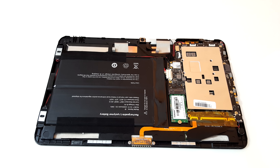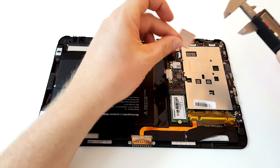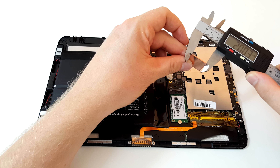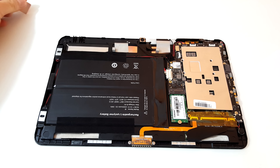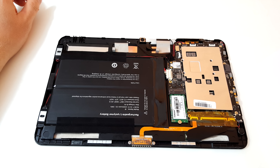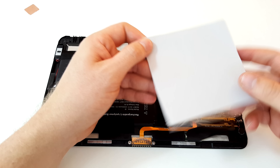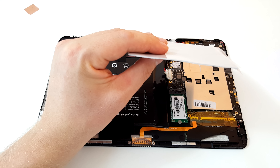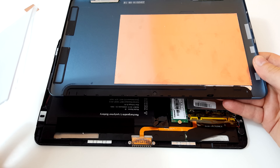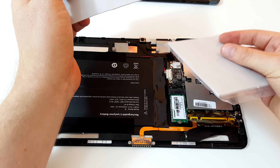There are a couple of things we can do. On other Cube tablets like the Q8, all I did was put a 20mm by 20mm copper shim, one millimeter thick, on top between the aluminium and the Core M die below. If you want a quick and easy fix, you could just slap on a large thermal pad. You can buy all these parts off eBay. I've got a nice big thermal pad here that's one millimeter thick, and also a two millimeter one — you could cut that to size; something like that would probably lower temperatures by a good 10 degrees.